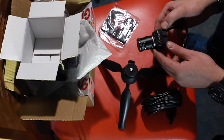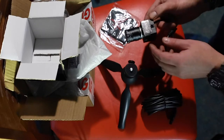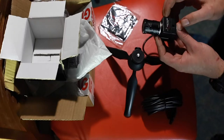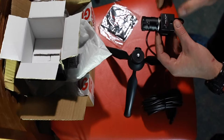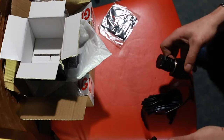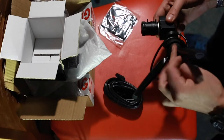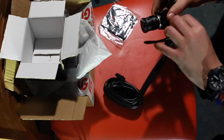The camera can be mounted either way — it's got a mount top and bottom, so you can ceiling mount it or tripod mount it. What you need is the sticker on the top facing up, so don't mount it upside down. Just make sure the sticker is facing up and you won't have any problems. Screw it on — ideally not plugged in so it's easier to move. Get it started and then it's easier just to move the tripod, then tighten up the last bit.